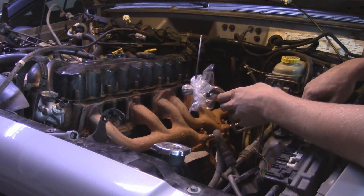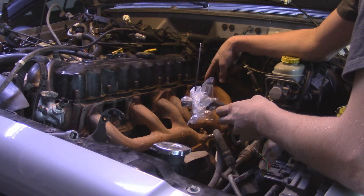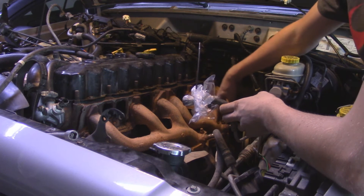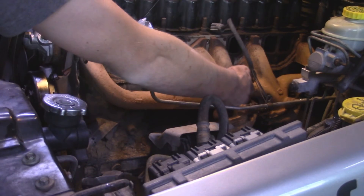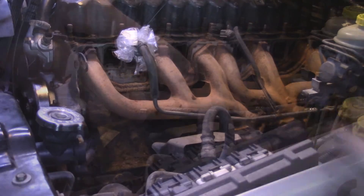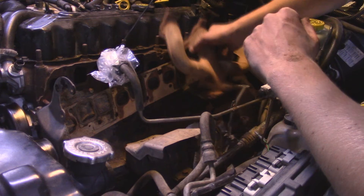So now the next thing we've got to do is remove the exhaust manifold. There are going to be two bolts on either end of the engine, and then we also have to remove it from the down pipe. I've got a Jeep with the California emissions, so it has split cast headers, and they actually have two collectors down here. So I can unbolt them right from here instead of having to go down even further where the other joint is. I can undo them right here from the engine and then we should be able to remove them.